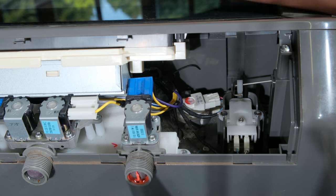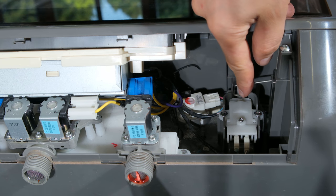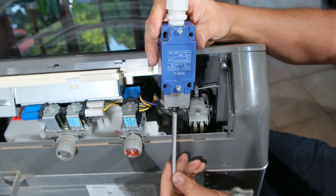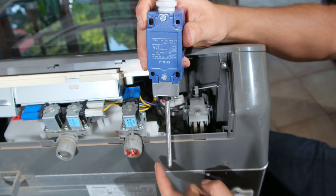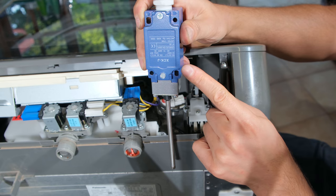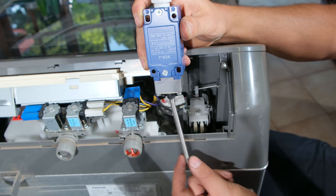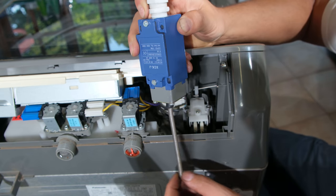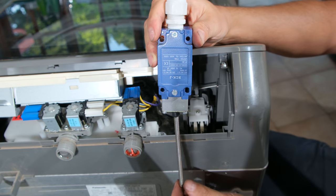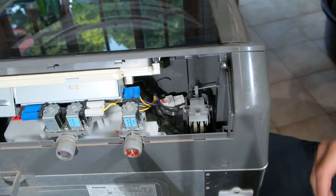These machines are quite light and can wobble, which can be dangerous. I noticed when I looked underneath there was no finger like I was expecting — a finger to monitor the tub. I have a limit switch here. This type is called the cat's whisker limit switch: in any direction, if you move it too much it opens a circuit. This is the proper way to do it but it's expensive, so washing machines use a cheaper plastic version instead.